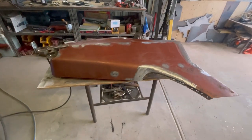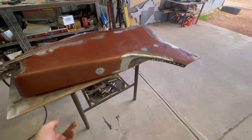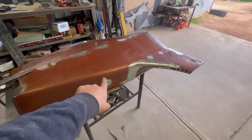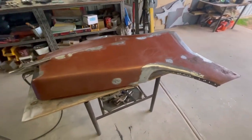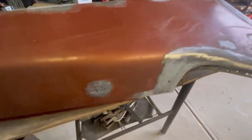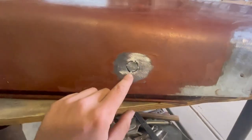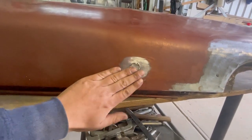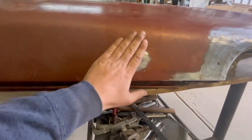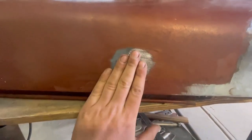Pretty simple stuff — in case you missed it in the time-lapse: I started off with a little bit of scrap, put it in from the back side of the panel, traced around it, then went over to the vice and cut the round section I needed out of it so it was close. Then I went over to the bench grinder, rounded it off a little bit, and did the fine tuning with my roll lock sander. I used a little magnet just to hold the patch in from the back side, got one tack on it, then hammered it up so it was flush. The main important thing is to make sure your patch panel is always as flush as possible.